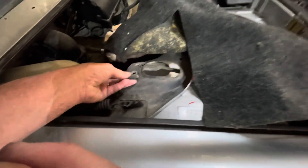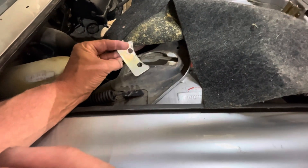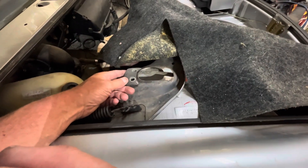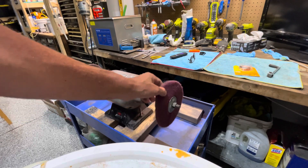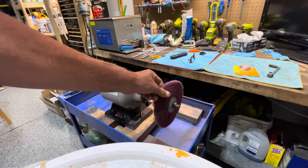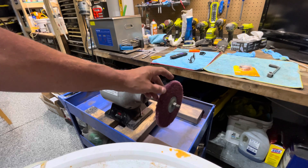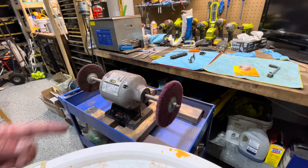First thing — I took this part out. I don't know why, but originally it had either zinc or yellow chromate on it, but somebody has painted it, so I need to strip the paint off and strip the rust off. I use these Scotch-Brite pads from Prime MX — I'll put a link in the description below. They are fantastic and just make the work so much easier to get rust off. I'll show you some examples of how to get rust off and paint off.